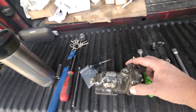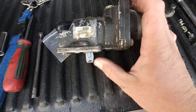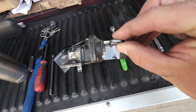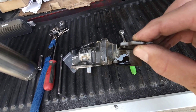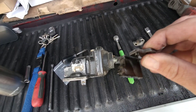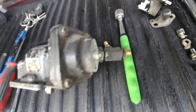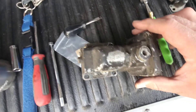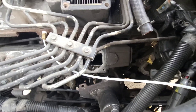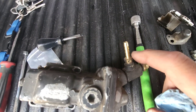Alright, got the AFC housing off. Whoever had this truck before, not sure why they would shave that off — usually you do that on the fuel plate, but I don't know why they would do that here. This is their fuel plate; I'm not sure which one it is, might be stock. That's coming out. They tuned the smoke screw all the way in, so I'm sure they probably messed around with the star wheel at the top as well.